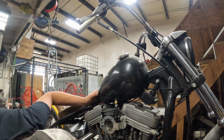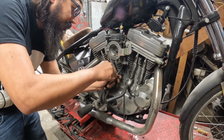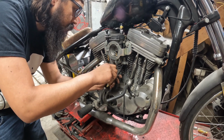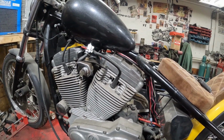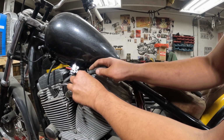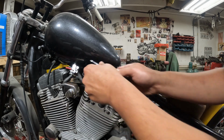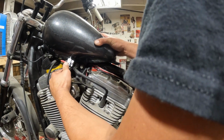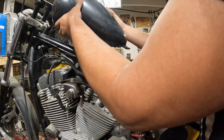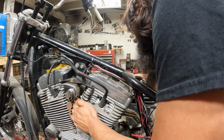you know what? This filter is not going to clear with the carb on. We'll split that down here. And we'll be able to get this glass fuel filter through the cylinders. Which way? No, we'll pull it off on the tank. Just separate this right at the tank here. So, tank's free. Get the fuel line down this way. Much more room.